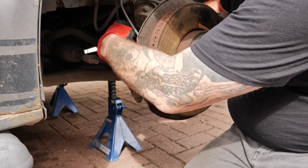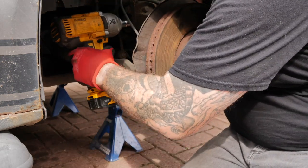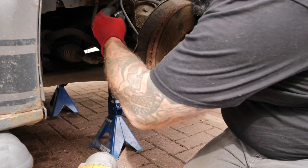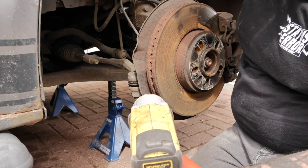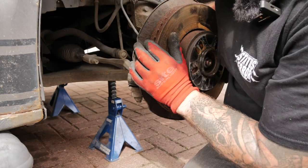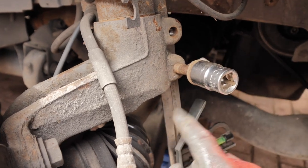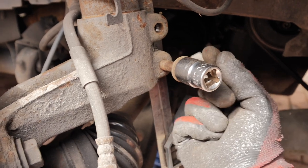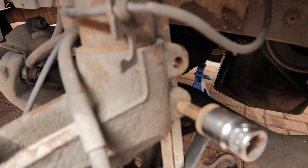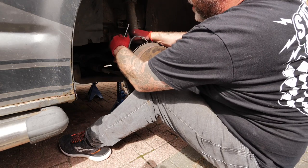These two bolts around the back are a weird Volkswagen size — 18mm. Got those out with the DeWalt impact driver, best thing I've ever bought — it makes everything so much easier, and because it impacts out rather than pulling on a ratchet you don't round off nuts as much. Now to get the clamp off I've come up with a cunning plan: I put one of the bolts in from the opposite side, used it to push into the gap and open up the clamp from behind. Tightened it slightly and it's opened up enough to work off.